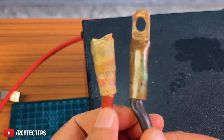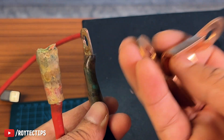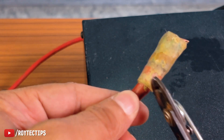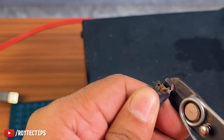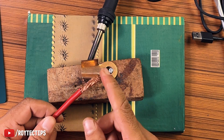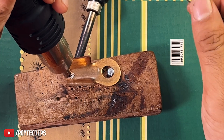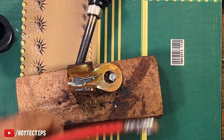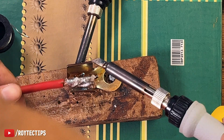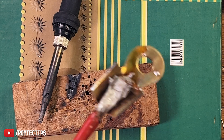Now we're going to cut this inverter battery connector. I bought two copper terminals — first we'll cut the red cable from here. I'm going to solder this cable onto the terminal since I don't have a crimping machine. I was able to solder the wire to the terminal.